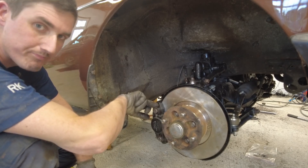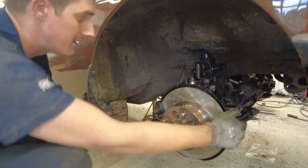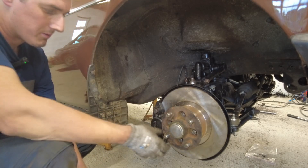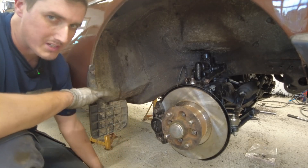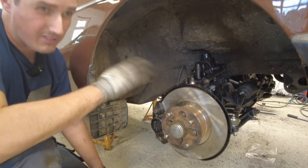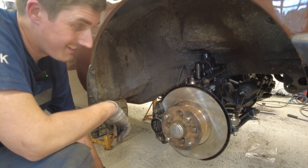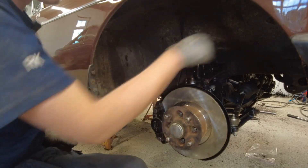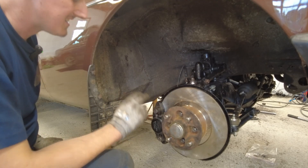We'll have fully functioning brakes at that stage and also fully functioning suspension, and the steering should be fine. But before I put the road wheels on, I'm going to grease up all the suspension - there are grease nipples on this so just general purpose lithium grease, give it a couple of shots on each one, and I will do the drive shaft and check everything else over. I've set myself a deadline - I'm going to a James Taylor concert on Monday night. Today is Saturday. I'm bringing my dad to see James Taylor on Monday and I'm hoping I'll be able to bring him to the gig in this car. We still have to put the anti-roll bar on as well - it wouldn't drive very nice without that.